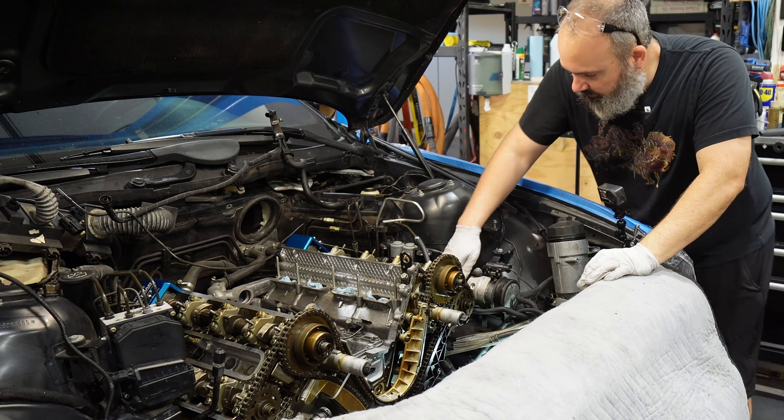Another one of those 'great while you're in there' spots: your oil filter lines. They drain down through the engine mount bracket and inside of that bracket on the top side there are two O-rings. I've got an extension on a swivel at the bottom, snaked up around the header and then through the two brake lines on the ABS pump, and another swivel up to the top on a 13 mil — we're going to try to break this guy free. We're replacing the O-rings because with the timing cover and the alternator out of the way, this is the best access we're probably ever going to have to these.